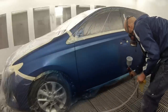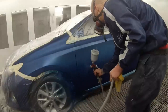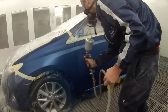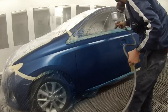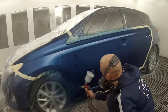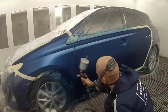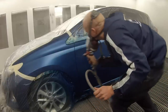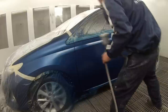These first two coats you're just going for coverage more than anything. You just want to bomb them on, just start to get the colour right — get it so that the whole car is the correct colour. We'll then give that a couple of minutes to flash off. You can see it starts egg-shelling — it's a similar gloss to an egg shell so it will dull off in between coats. The second coat will still go for a nice wet one, and after that you should pretty much have coverage over the panels of the right colour. The next coat after this will be our effect coat.